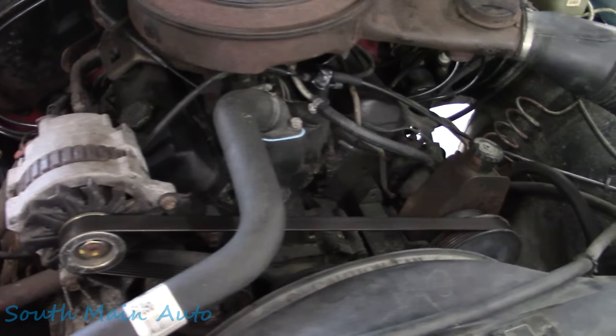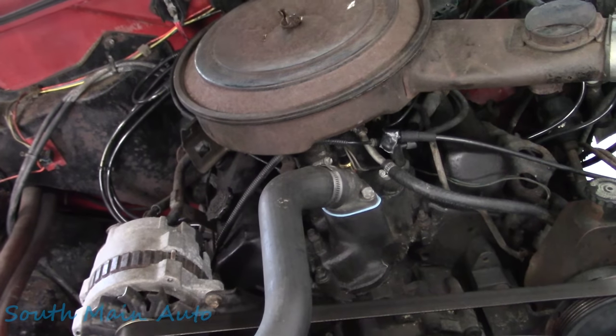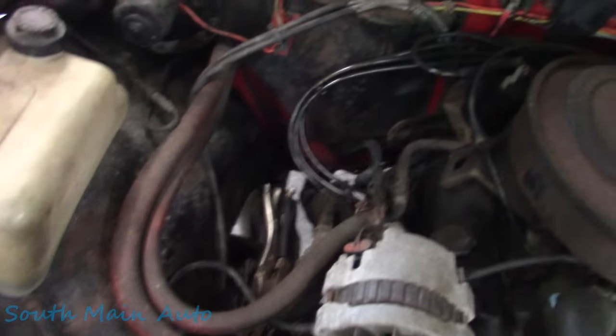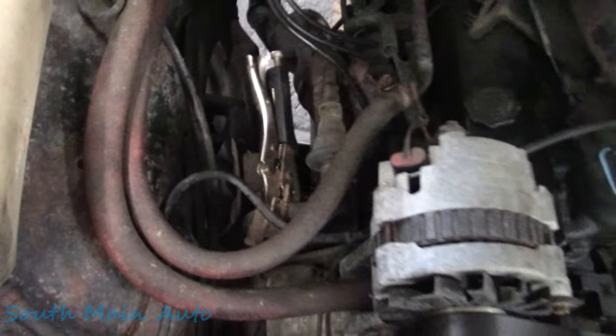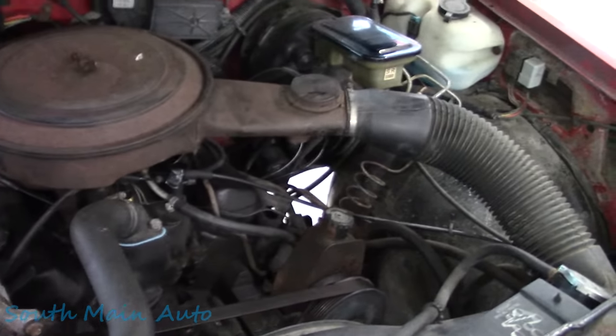He's done a lot of things: a coolant sensor, map sensor, throttle body injectors, and thermostat, and plugs, wires, cap, rotor, coil, all the parts you can throw, including the vice grips on the air pump. And now we have to find out what's really wrong with it.